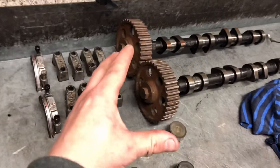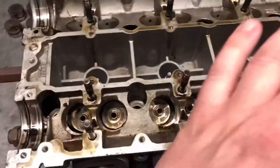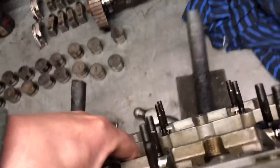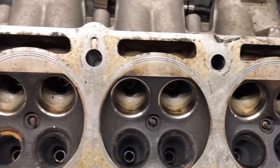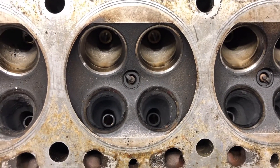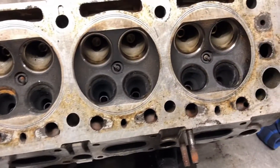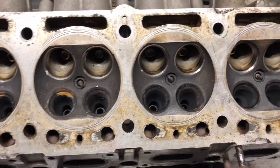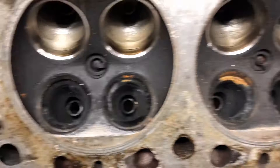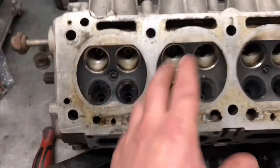You can see the front pulleys — these are standard front pulleys, they've got a bit rusty where they've been sitting, and again on the lobes of the cam, so we're going to be cleaning those up. We're going to give this thing a good wash and soda blast the ports. Looking inside, you can see where we've got blow-by on the piston rings — on the old Sierras with the old ECU, by the time someone's chucked bigger injectors in, they usually eat the bores a bit and knacker the rings. You can clearly see where it's all black in the combustion chambers — that's been burning oil for a while. The exhaust ports are a bit coked up as well.